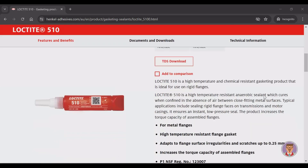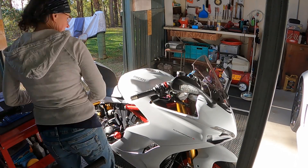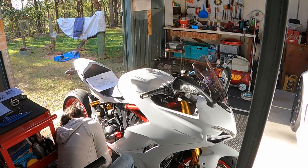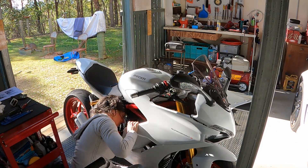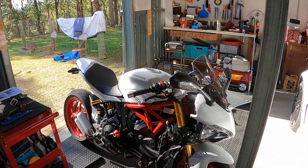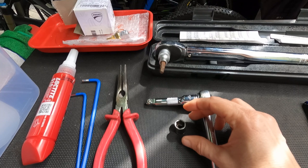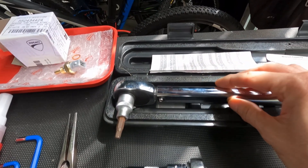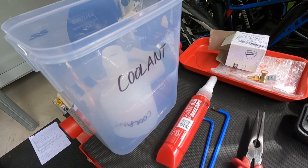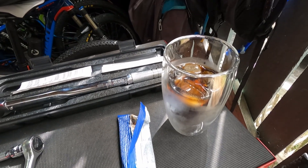With all the work Scotty and I do on engines for cars and motorcycles, I'm hoping we'll get to use the Loctite again. For tools, I used Allen keys — 4mm mostly, but I have a couple of bolts on my fairing that were 3mm. Both fairings need to be removed to more easily see the level in the coolant overflow reservoir on the right, and then on the left to get access to the temperature sensor. Needlenose pliers for clips, a ratchet with a 10mm socket for removing the battery, and a torque wrench for the water pump drain plug and the temperature sensor — though I later worked out I had no chance of getting the torque wrench in to the sensor. Also a brand new clean container for coolant since it was new and I reused it. And importantly, a homemade cold brew coffee and a protein bar.